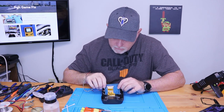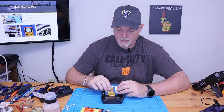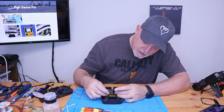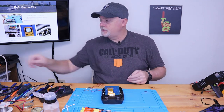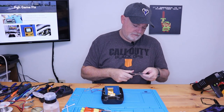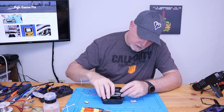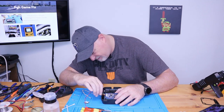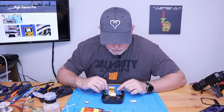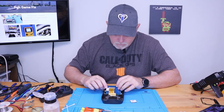and the driver board is going to be mounted with the double-sided tape provided. I don't recommend putting it on this ribbon cable, so let's see, what are we going to do with that? I'm actually going to split it so our board is supported on both sides. So let's just cut a piece off here. And since this is gonna fold up like this, let's sit just about there. Okay, I'm going to put it here and here, just beside our cable.